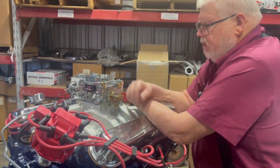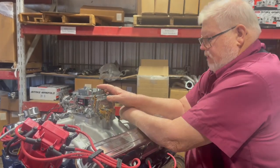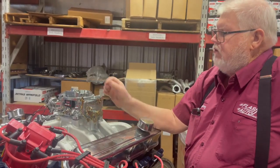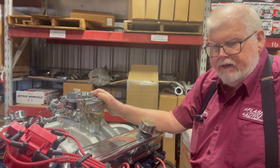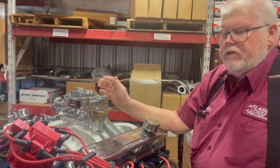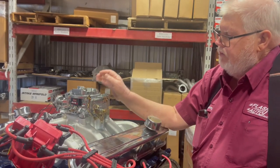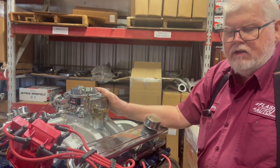No coughing, hiccuping, or hesitating. That's what you do with these carburetors — any of them that have an adjustable secondary air flap. This carburetor, if it was put on a small block engine that doesn't have the volume of air going through it, the original adjustment would probably have been fine. But these have a lot of air flowing through them on a big engine, and what I was doing was just pulling it open way too quick and creating a lean spot.